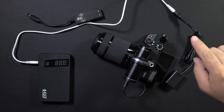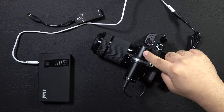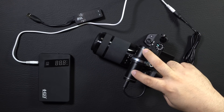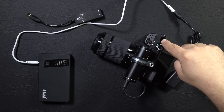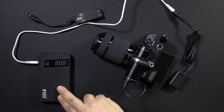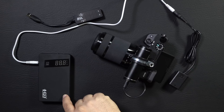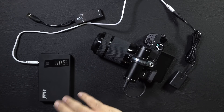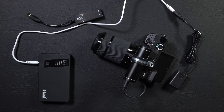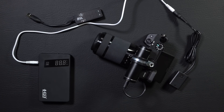Let me summarize. Internal battery will heat the camera up very quickly — you get maybe 20 to 30 minutes of record time. Using the external battery pack, it handles about two thirds of the power while the internal battery handles about a third; the camera will still overheat, but it'll take about 45 minutes. If you go to a dummy battery at 7.5 volts, it took an hour and 15 minutes to overheat. At 8.5 volts it takes a little longer, suggesting the camera generates less heat at that voltage. You can use an external recorder to reduce the heat load, and turn off a number of options. Between all of those things, that should give you a very clear picture on how to proceed on your next project.